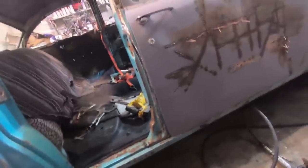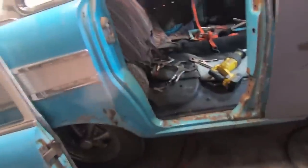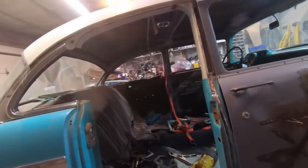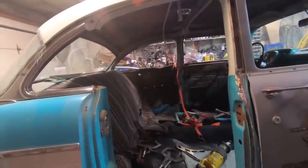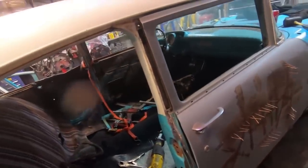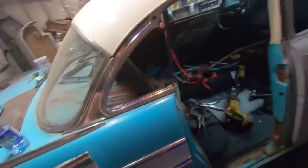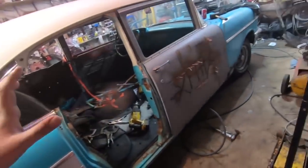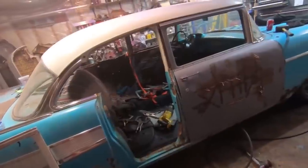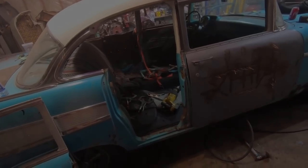Overall it's pretty good. I learned from watching the other side — getting this piece out early, now I know how to section the door. I'm probably going to need to cut another door up to add a little length there. Tomorrow I'll peel the trim back, do a little bit of grinding around the edges, and then skin the door — chop the top off, put the skin on first, then go around the same as the other side. There's no framework on the inside yet. Overall it turned out pretty good and it's going pretty quick. It's been about four or five days. In a week it should be looking like a two-door. Anybody can do it — it's just grinding and welding, nothing too crazy.